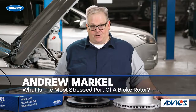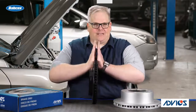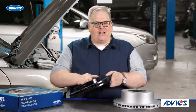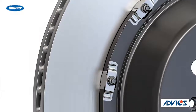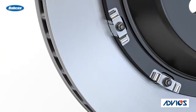You may think that on a brake rotor the most stressed out part of the entire brake rotor are these plates and the fins as they're getting clamped down by the brake caliper. Well it's simply not true. The most stressed out region on any brake rotor is where the plates meet up with the hat of the rotor. In this very small intersection of the plates and the hat of the rotor itself is where most of the stress on a brake rotor is.